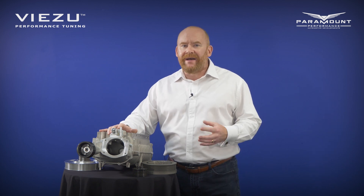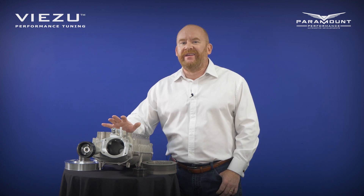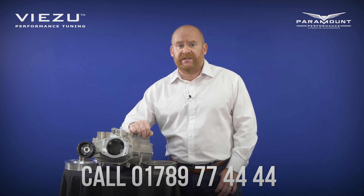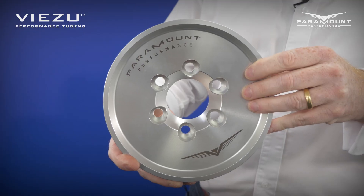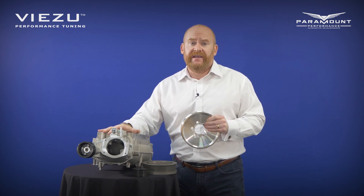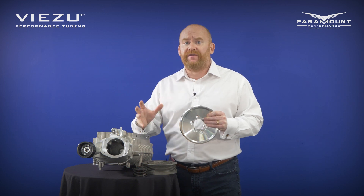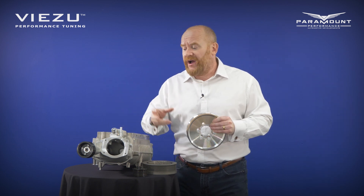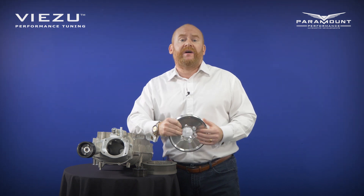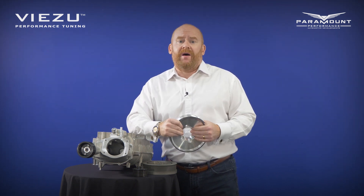I hope you found that interesting. My advice would always be: if your supercharger starts to make any noise — anything rattling or gravelly from the top of the engine — get professional advice as soon as you can. Don't leave it; it's not going to fix itself, and an early repair will be much cheaper. If you're looking for more power and performance and want to change the supercharger pulleys, we have both in stock. I'd always recommend that if you're fitting the lower pulley, you run it with a remap — you're adding more air than the ECU can fully adapt to on its own, and you'll need to add more fuel to match. That's something we can provide. I hope you've enjoyed the video; if you've got any questions get in touch, do sign up to our channel, and we're looking forward to seeing you again soon.